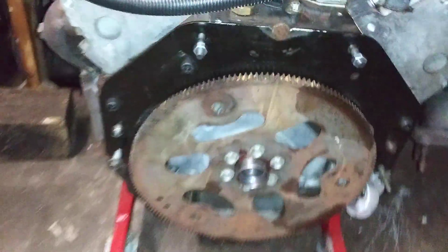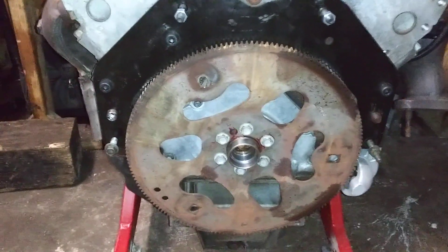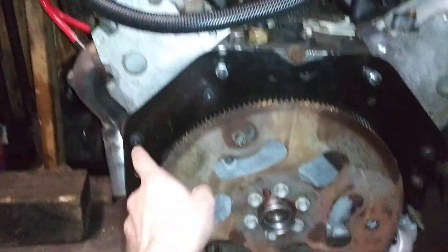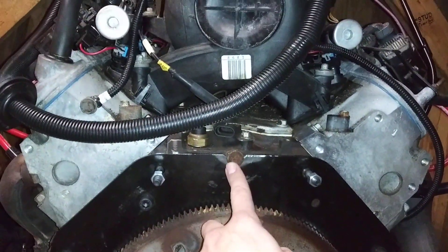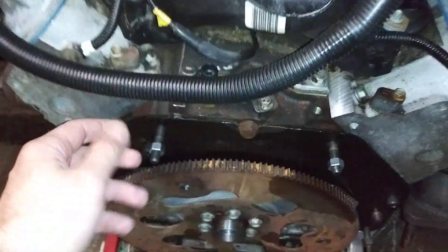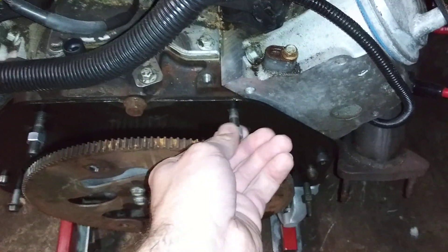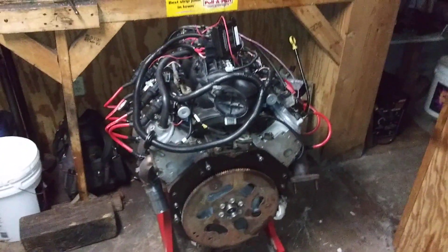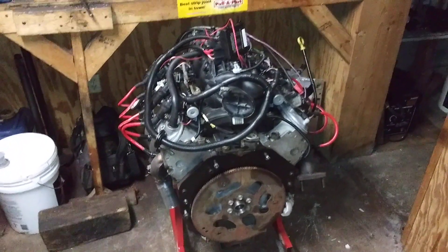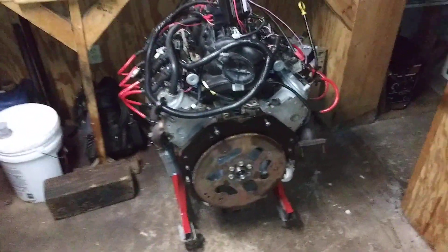The only other bit of an update is I got the adapter plate ready to rock and roll. I'm gonna bolt the turbo 400 up to it next. Standard metric bolts on the bottom — I went to the hardware store and got Allen head M10s. I added a bolt up here and this was going to be an issue running a bolt because there's a boss behind it, so I just used two hardened studs — coarse thread on the inside and fine thread on the outside. Next video update I'm probably gonna get the transmission bolted up, go through the spacers, and make sure the converter works.